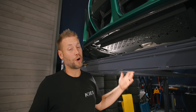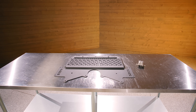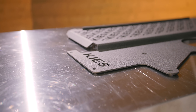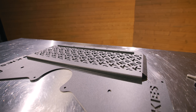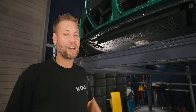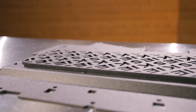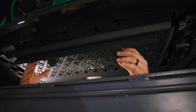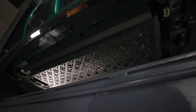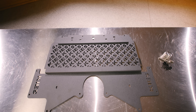While we are here, I do want to show you our new skid plate. On my old F80 M3, I had a situation where I went up a driveway, there was a little bit of a dip, and I smashed it on a rock — absolutely smashed it. If I didn't have a skid plate, I would have destroyed my oil cooler and probably had engine failure. Another cool thing about this, just like OEM, we have a spot for this rubber flap to go on. As the air is going here, it hits it and ducks down — it's going to change the pressure in this area and help evacuate the air to help with airflow and also cooling. Keep an eye on the site because that's going to be listed out very soon.